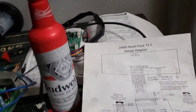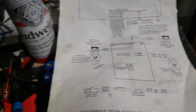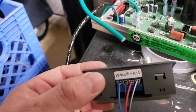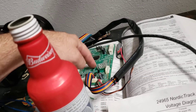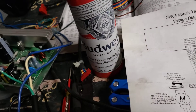When you go through the treadmill, you might be lucky enough to find a voltage diagram, as I have. Basically, that pulse width modulator hooks up to this connection right here. I just deleted most of the wires and kept the only ones that I needed, which are the voltage positive and negative, your ground, and your pulse width modulator. This comes from the main circuit board right here — this is the MC2100, which is this big one. That's really the only one you need.